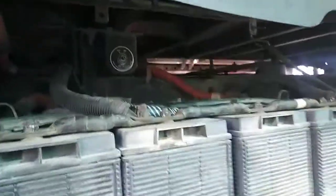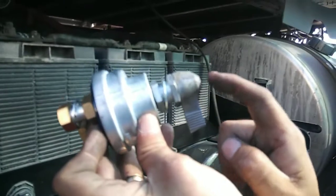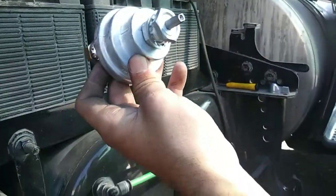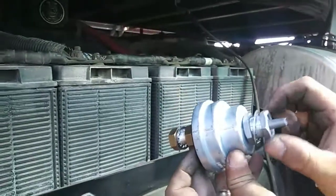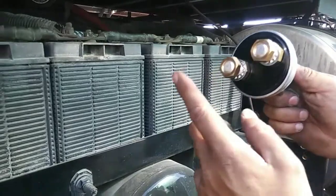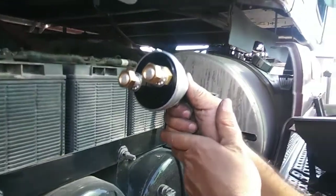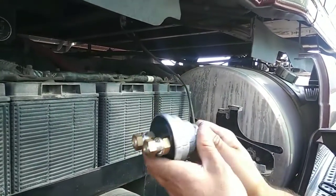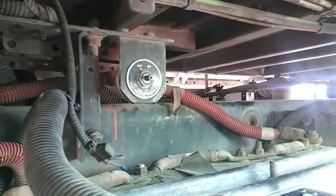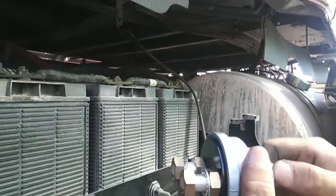My switch is down here right above the batteries. The first thing you're doing is taking this little guy off — it's got a little screw right there and it's real easy. You take this one off as well, and then you've got two nuts in the back which are where the negative and positive cables to the batteries go. All I'm gonna do is loosen up those two nuts from the back, hook up the cables to it, and it should be ready to go.